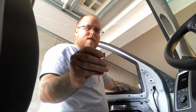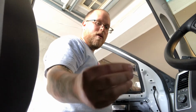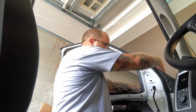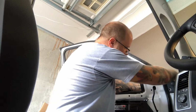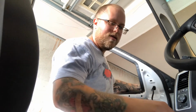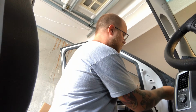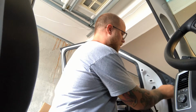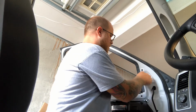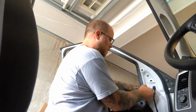I did forget to take out this little metal tab from the other mirrors because this one has it on there. So on the other side there's a little metal tab. Take that out. And guys, if you have any questions while you're doing this, just leave a comment. I'll respond. So get your nuts, which should fit. Hand tighten them on there to hold it so you don't have to hold this thing up yourself.